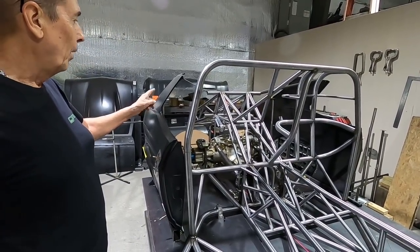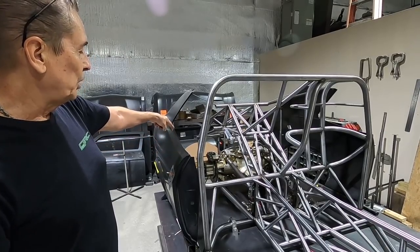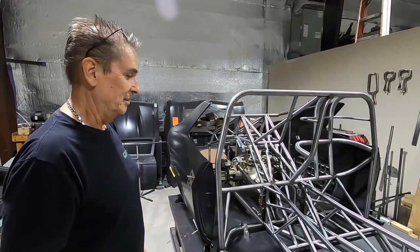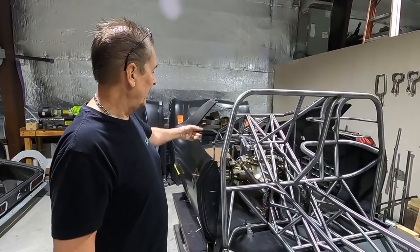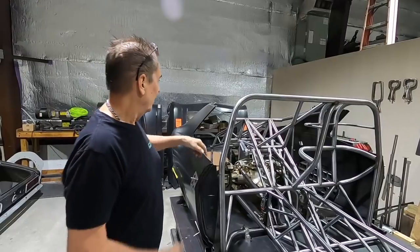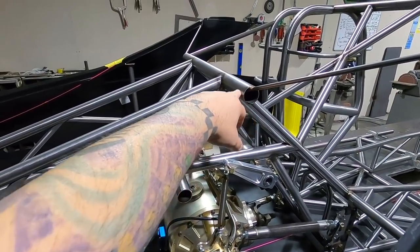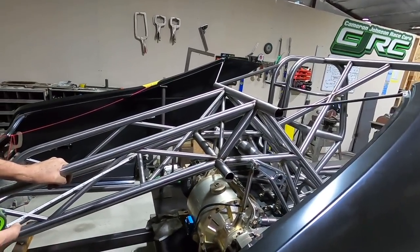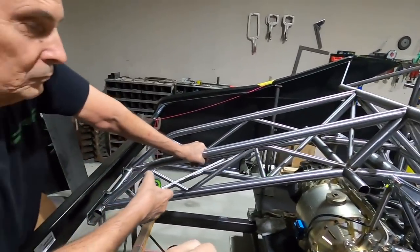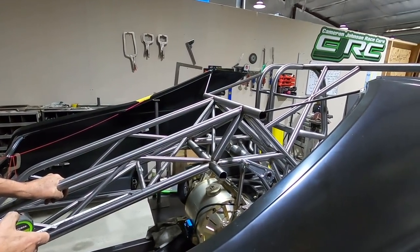Then comes the fun part — you have to determine where your upper shock mount bar is going to go. Once you have the rear end centered and set to the length you're going to use, you have a shock bracket on the back. This particular rear end is not adjustable, so you've got to be spot on with the shock mount height — you can't just pull a few bolts and move it up or down. You determine that, then go straight up the prescribed amount depending on how long your shock is. We then set the tube in a jig — we usually run that tube as high as you can to the rear window. In this case we can run it right up against where the window goes to get the tubs up high. This car will probably always run 275, but if it ever went to big tire, we'd have no clearance issues.